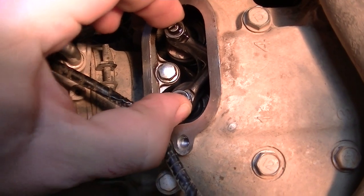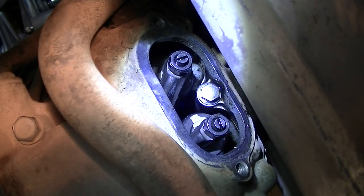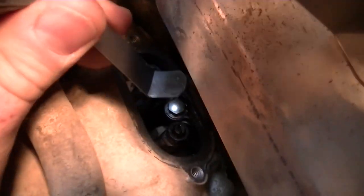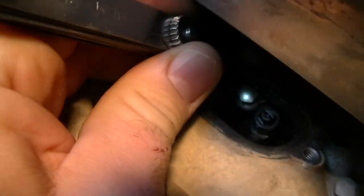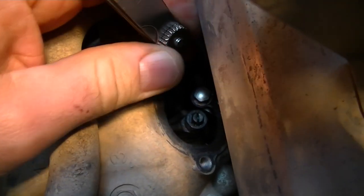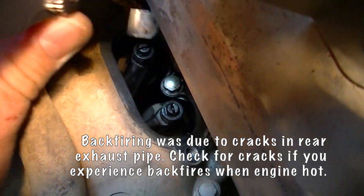So now we've got our intake valves here at 5 thousandths. Now what we need to do — the tricky part — is get that exhaust valve. This isn't going to be the hard one because I've got access to it. So we're going eight thousandths back here. I'm going to first see what I can get as far as a reading and see if they're loose or if they're too tight. I had to improvise and bend this because there's just no way I was going to get in there, so I just made my own. I'm in there — it is a little loose. I did experience some backfire occasionally going down hills, so I'm going to tighten this up to 8 thousandths and then get this other one checked.